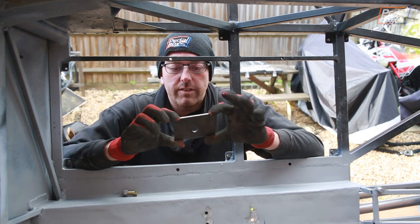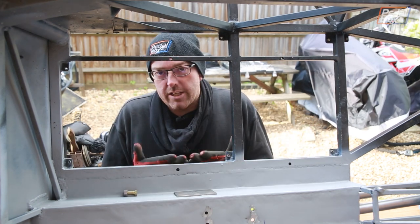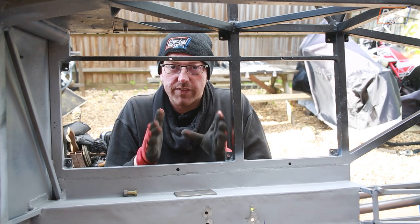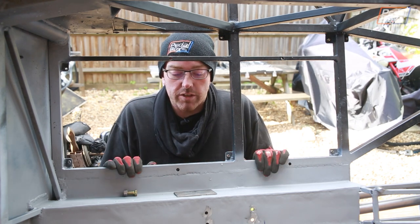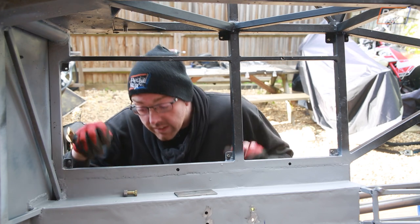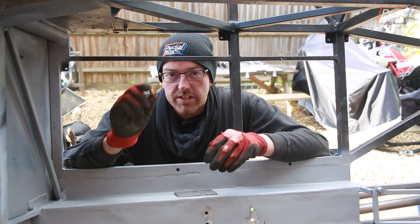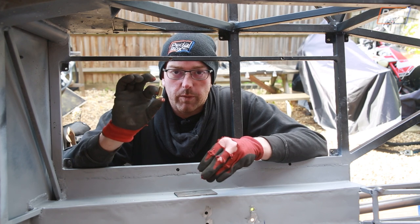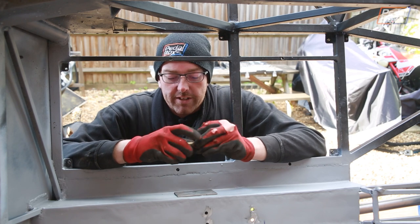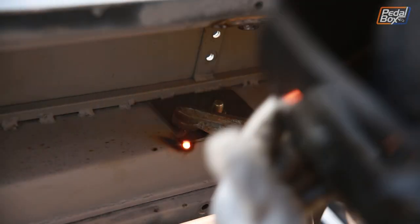This is the plate we've got — it fits within the minimum specifications for the MSA's positioning and rules on the backing you need to put behind it. You can just use a big three-inch washer, but ultimately you need enough square inches or square centimeters of surface area behind any sheet metal you're bolting into. So we've got a nice big patch of steel to put behind the sheet metal and we can reinforce it more if we feel the need. The MSA also requires you to use a 7/16 UNF thread — these are the standard ones Audi use — and we've got a couple of UNF nuts to go on the other side. Before we can get this in the right place we need to drill a hole through the tunnel and bolt this down so we can tack it in place and get everything spot on.